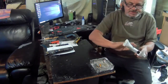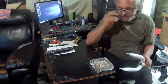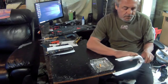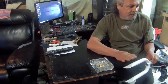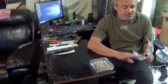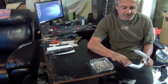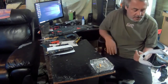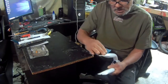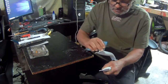What I'm going to do is just sand it down a little bit by hand. I'm going to use 120 grit sandpaper, which is going to be fine once I paint this. It'll be nice and shiny — you'll see no scratches or anything. There's no need to go to 240 or 300 sandpaper. 120 is sufficient. Just taking the shine off the paint so the new paint will stick to it.